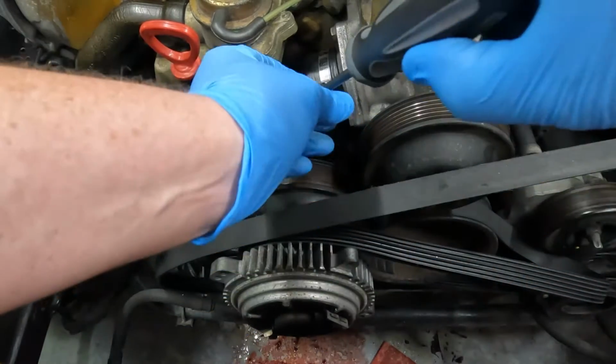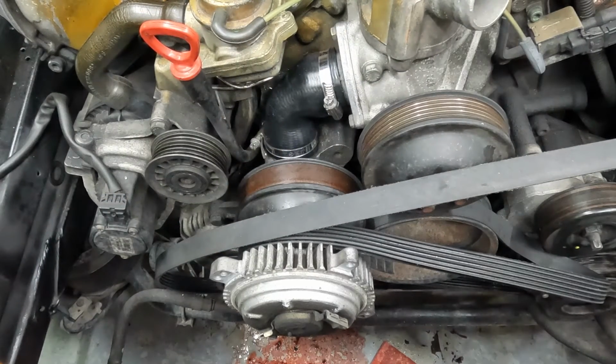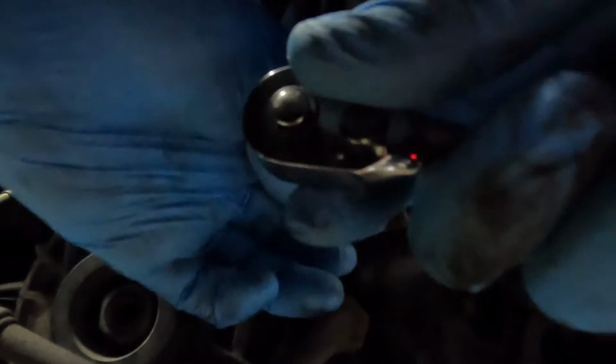All right, and the hardest hose to replace on Iona is done. We gotta put our hose on. Make sure it's in, tighten. You gotta put the lower radiator hose on first, because if you don't, this clamp is very, very hard to get to because of the fan. We'll put the fan on next. There's 4 10mm bolts that hold the fan on. This is a 7mm Mercedes Benz hose. Come on, baby, get on there. You know you want to. There it is. We'll tighten this down. All right, she's tight.